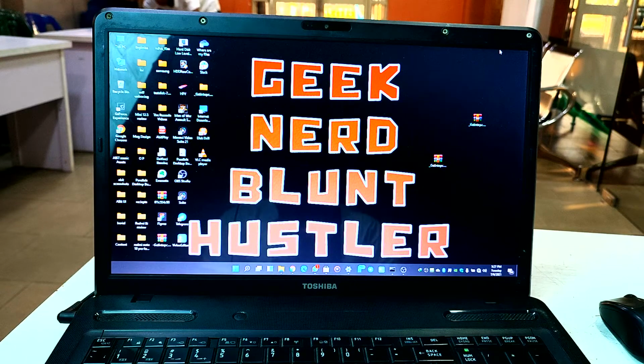In this video, I'm going to be showing you guys how to install Windows 11 on an old legacy system. When I say an old legacy system, I mean a system that does not meet the installation requirements for Windows 11. A system that is very old, basically has not started using UEFI, which is the latest version of BIOS. It doesn't have TPM, which is one of the requirements for installing Windows 11. Basically, old legacy hardware that you have available.